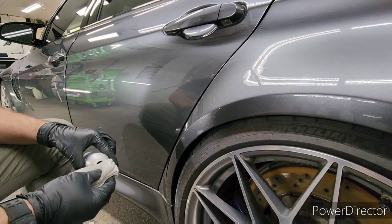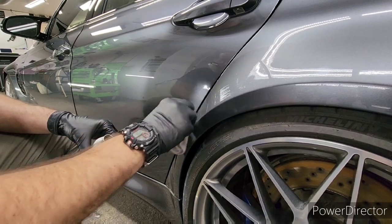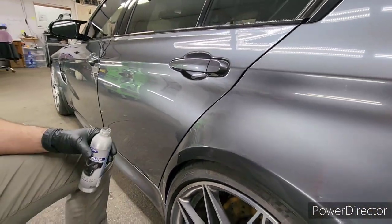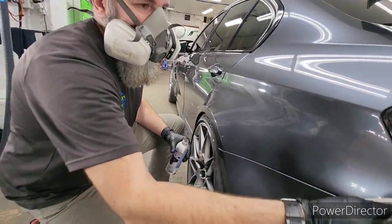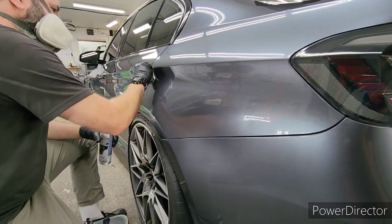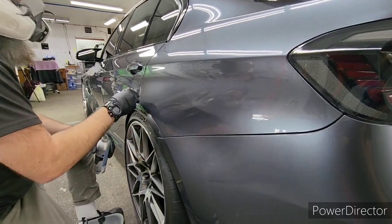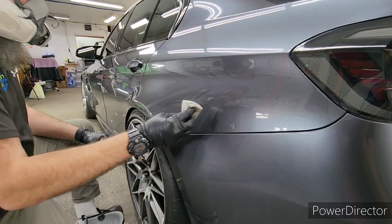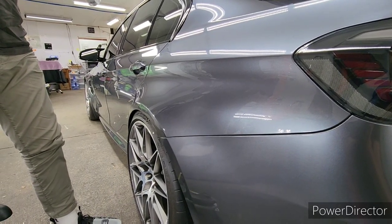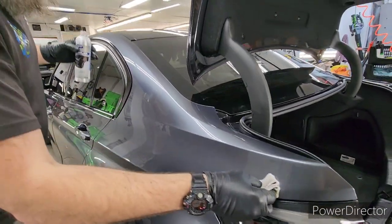It's a great product for when polishing really won't do any good, or when polishing would remove too much clear coat. Mainly I wanted to add clear coat here because I'm installing my five-layer ceramic coating on this vehicle and it just needs a good base to stick to. Coatings perform based on what they're bonded to — if the paint is neglected and thinned out, the coating will perform accordingly. Even a really good lifetime coating may fail if the clear coat is not in good shape.